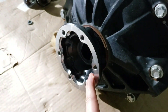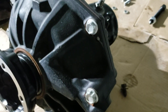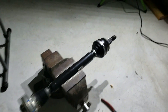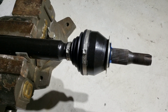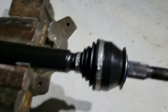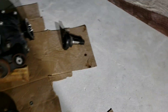These are the V8 SS axle flanges. Both sides use a slide hammer to take them out — I'll show you that in a second. That way we can mount the axles in when we take the other diff out. I got these axles for 50 bucks and that's one of the reasons I wanted to change them. You don't have to — you can keep the V6 flanges and use the current V6 axles — but why not upgrade when you're doing it all? We also had a bad CV boot on one axle so we had to change that out. That was the beginning of our day — never done any of this before, so we're just learning as we go.